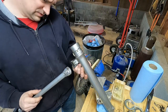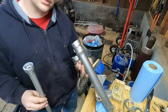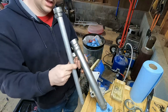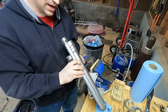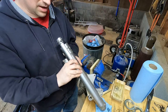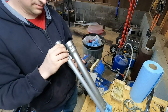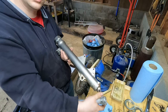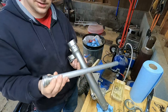I wanted to show you what I've done to get this damper rod out of this fork tube. On any cartridge fork, this is the cartridge, and what happens is this gets screwed down inside at the bottom, and there's a cap that goes in the bottom that screws into this to hold it together. The problem is the rod is sticking out of the top, and there's really not a very good way of grabbing it. So when you try to turn this bottom nut out, this just spins on the inside and you can't get it off.